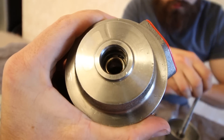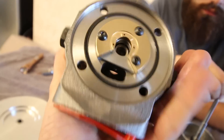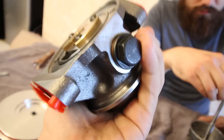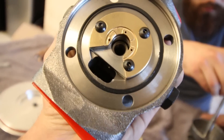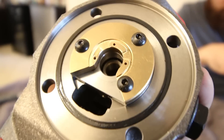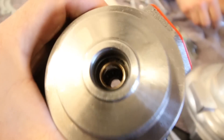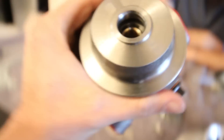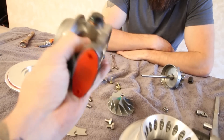It looks like it's journal bearings in the back, and then they do have ball bearings in the front. But the issue with that is, what type of restrictor, if any, do you use in this? We would rather just have either a journal-bearing turbo or a ball-bearing turbo. I wish you guys could see that better, but in the front there they do have ceramic ball bearings. In the back there's journal bearings.